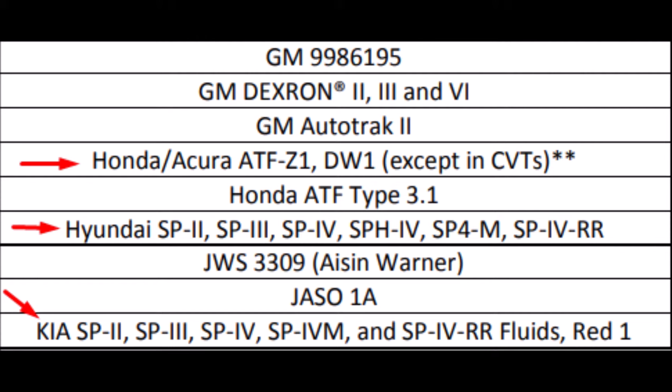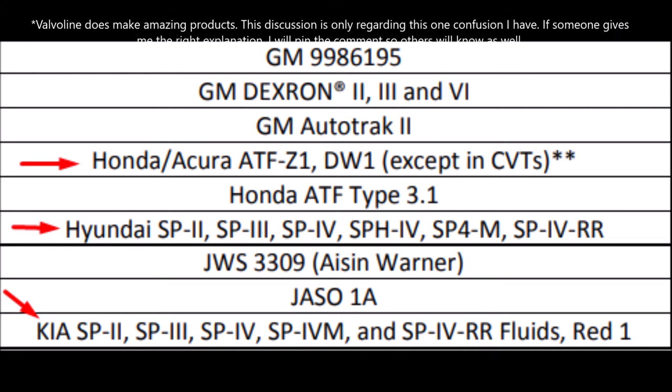My reason for not using Valvoline is this. If somebody can answer this question of mine and leave a comment in the comment section, it would be great. As you can see, this particular ATF is compatible with Honda Acura ATF Z1 and DW1 as well, and SP2 and Hyundai SP2, SP3, SP4, SP4M, SP4RR as well. But my confusion here is ATF Z1 from Honda and SP2 and SP3 from Hyundai are thicker in viscosity, whereas DW1 from Honda and SP4, SP4M, SP4RR from Hyundai or Kia are thinner in viscosity.